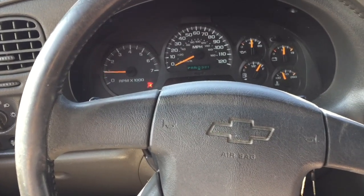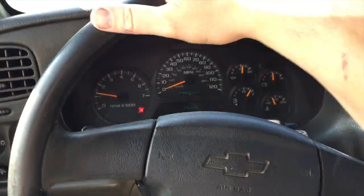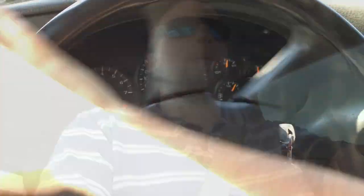I can see that my steering wheel went to the right just a little bit and the brake pedal did its buzzing noise. So I think that my driver's side wheel speed sensor is bad or it's just not getting a very good reading. I've done some research on this — the hubs can get some rust scale built up on them and cause the wheel sensor to actually raise out of its spot.